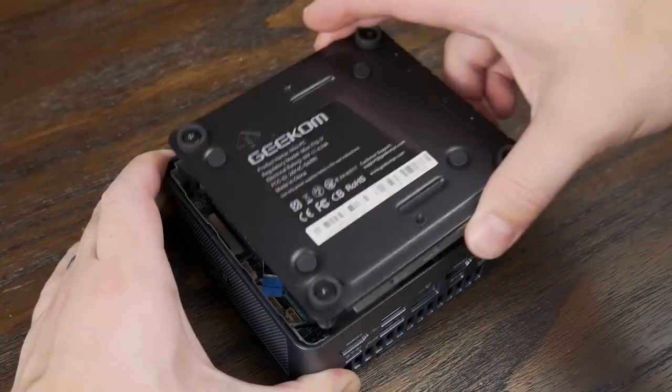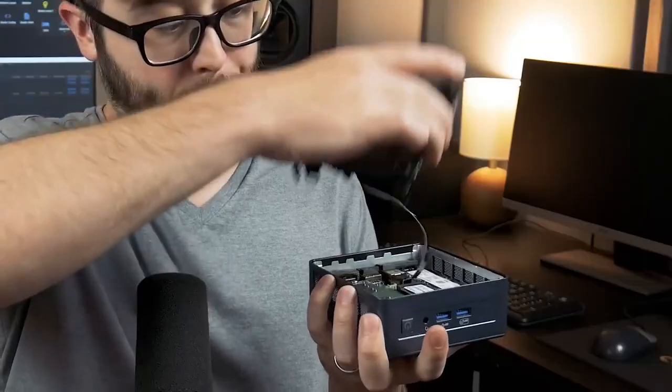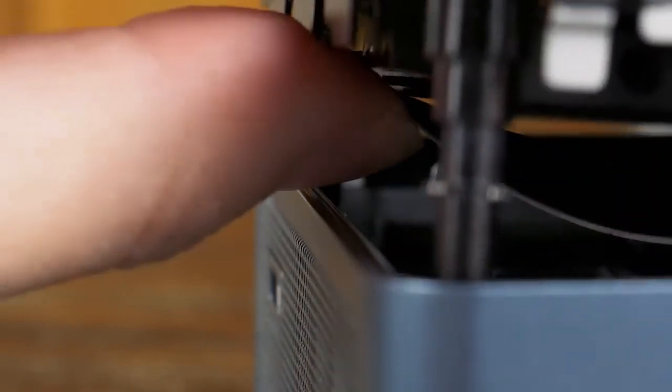This actually brings me to one of my favorite things about this system, which is how simple and easy it is to open up. There aren't any glued-on rubber feet over the screw holes or plastic clips to break off — it's just four screws and you're in. The screws are actually captive, so you don't have to go hunting them down with a magnet when you inevitably drop them on your carpet. Inside, there's also a 42-millimeter SATA M.2 slot, as well as a ribbon cable that goes to a 2.5-inch drive bay. I really like the drive options and how accessible it is; however, the ribbon cable for the 2.5-inch drive seems to not be in the best spot, as it often wanted to get itself pinched when closing the case. It's a small detail, but I don't imagine this cable is super easy to find and replace.